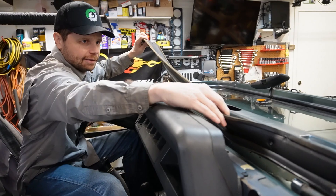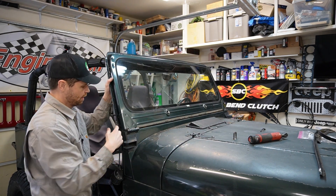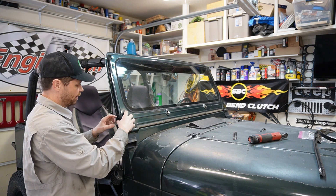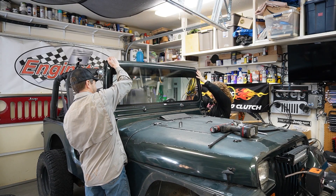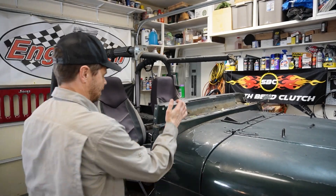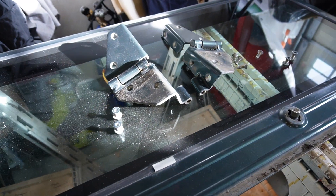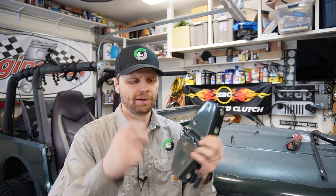Definitely got to order a new gasket here. I did decide to go ahead and take this frame off — it's just going to make it a lot easier to sand and paint. And I do want some of these screws out for painting so that if I ever have to remove the windshield or take the windshield hinges off, it's not all glued together with paint. You can take the screws and bolts out without wrecking the paint. So I'm going to take it off. Tip it down — there we go, we can just lift it off. Getting these hinges off is the hardest part. On the driver's side, these bolts have 13 millimeter nuts on the inside and they just spin. You've got to get your hand way up under there underneath the dash — it's super hard to get a wrench on it. It was a pain, but I finally got it.